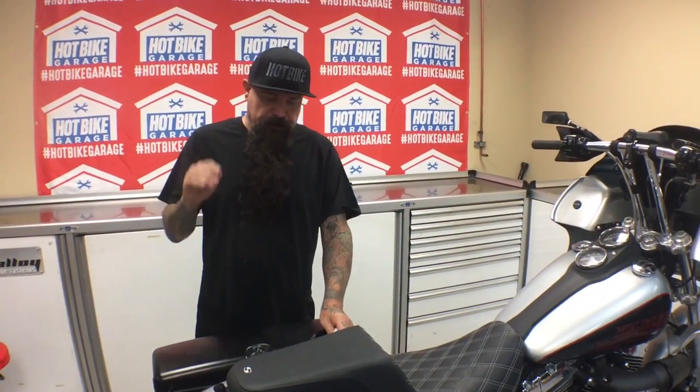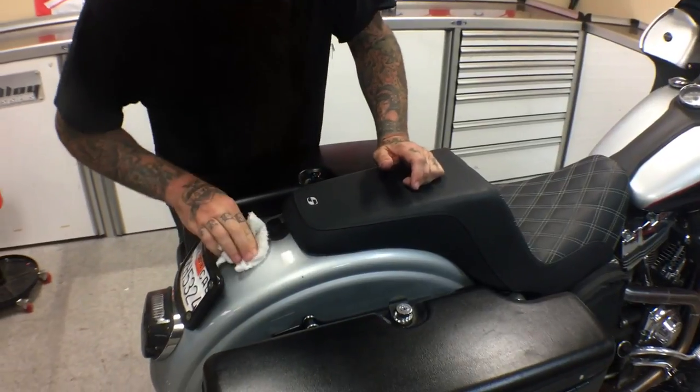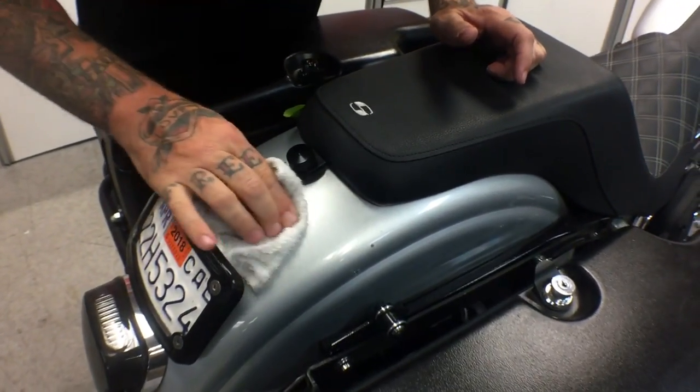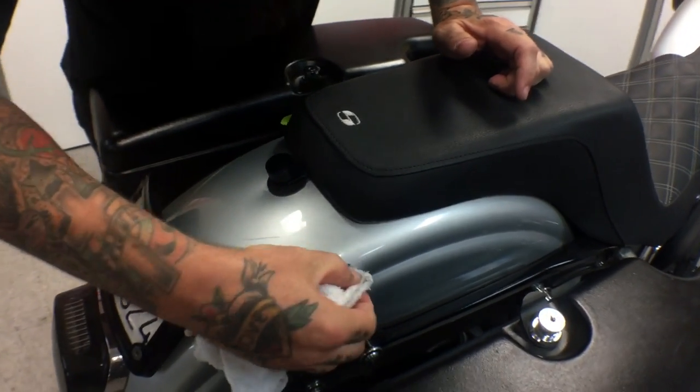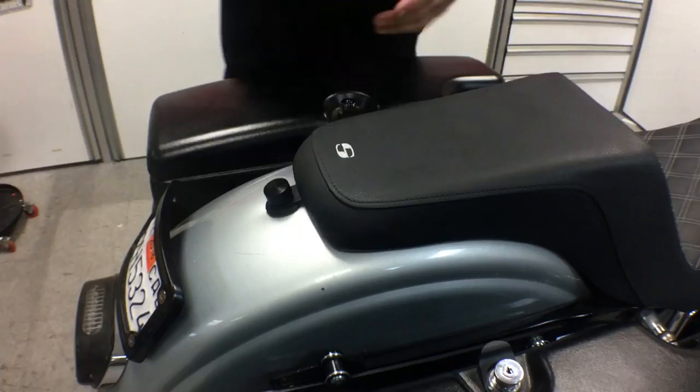To start the process you need to wash the surface. That's going to clean everything — there's not going to be grease and grime on there. Paint doesn't like to stick to stuff that can't be stuck to. So we're going to clean the surface with a little soap and water on a rag, just get in there, scrub it a little bit, and get really inside that scratch and that nick as well. Then we're going to let that dry.